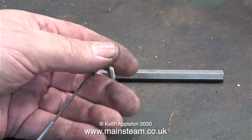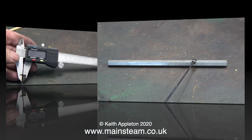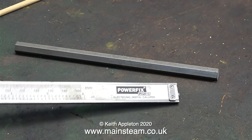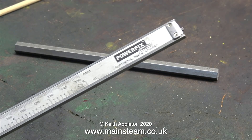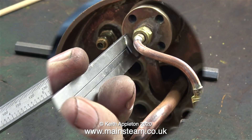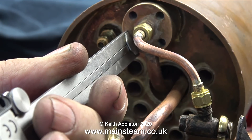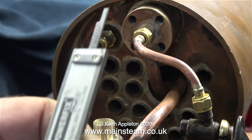If you want to know more about the metallurgical principles of stainless steel, just Google the words 'stainless steel.' This is my digital caliper, and this bit at the end is a nuisance most of the time, but for once it's going to prove useful. I'm going to use it to find out how long I need the bolts to be. I stick the probe into the hole in the wet header, making sure I go all the way through into the threaded part of the wet header bush. And this tells me how long the shank of the bolt has to be.